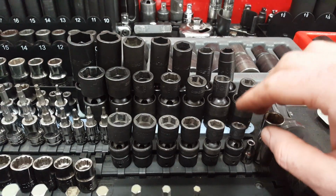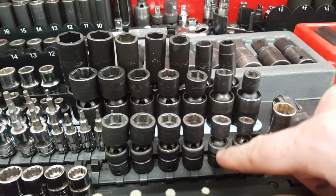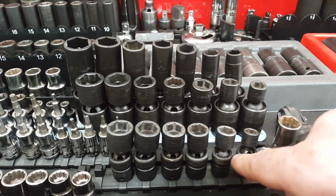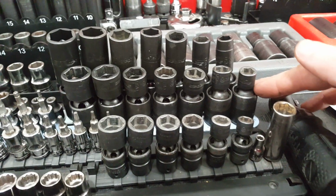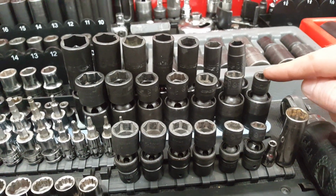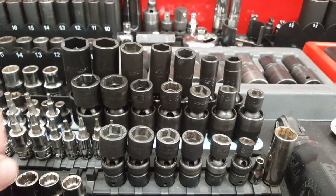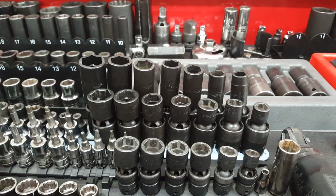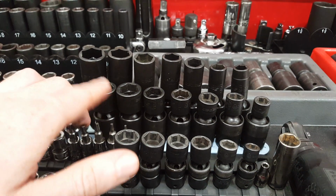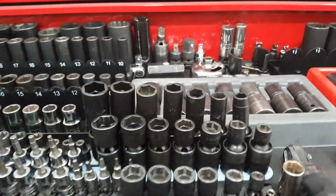And then I really like these impact swivel sockets, specifically the 1/4 inch drive ones. The thing I like about these quarters is you look at the ratio of the body to the head, and this is really good for getting in tight spots. You move up, I've got the 3/8 one here as well, but you look at how big the body is here, and you're trying to get into a spot that's going to have that size of fastener, and it just makes it very difficult a lot of times. So these come in handy on things like bell housing bolts, stuff where you're not getting in tight spots, but you need that angle, and so that's why I've got them. Got that little deeper set there too.